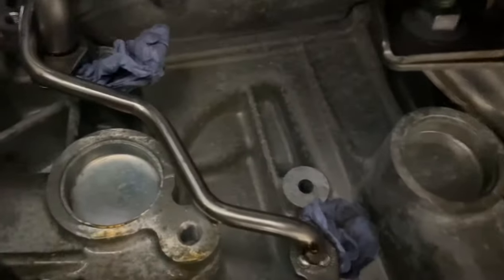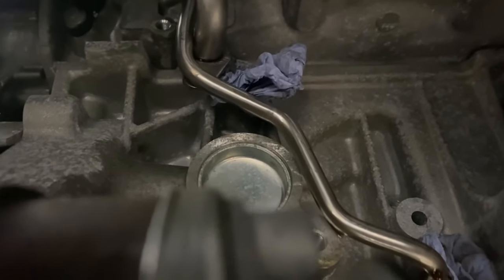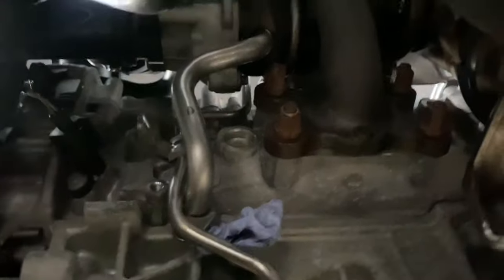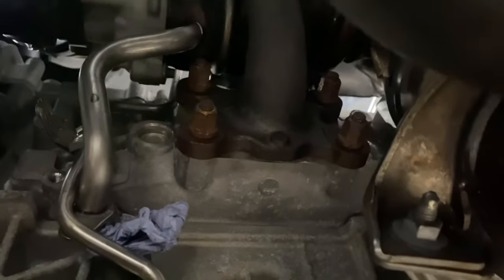As you can see, I'm going to remove some bolts — those are the oil return flow pipes from the turbo itself. The actual bolt holding it is a T30 star tool. To remove it, I'm going to remove both those return pipes with copper nuts, as you can see, that go onto the exhaust manifold.